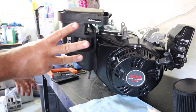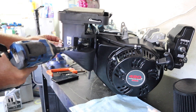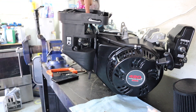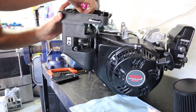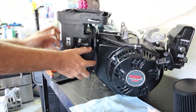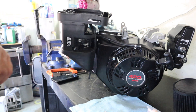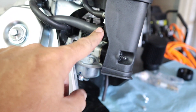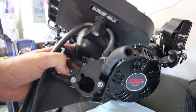To start this off, we're going to remove the air box. There should be three bolts and they're 10s — two right here, and then once you remove the little filter, there's another one directly up top. Now this whole thing should wiggle out. I forgot — there's two hoses in the back. We're going to unhook those. The back hose just slides right out, and that's your intake.